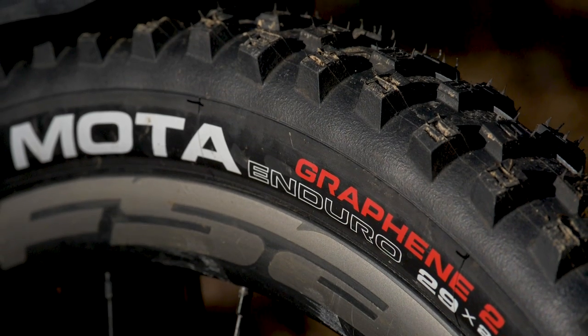There's also a fairly new thing called the Global Measuring System that some tire manufacturers are choosing to use. In addition to the measurements on the sidewall, WTB, for example, are actually providing two measurements — they measure at the shoulder of the tire, which on aggressive tires is often wider than the actual carcass. So it might be quoted as 57 and 60 with the 622. You might see that creeping in among a few other tire brands.